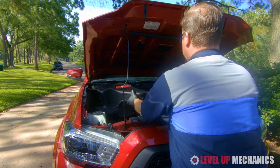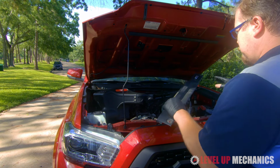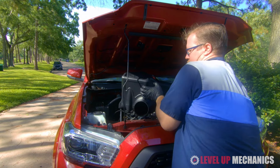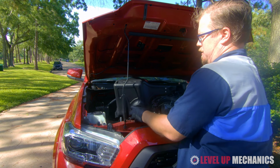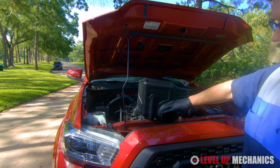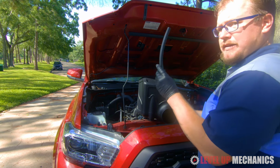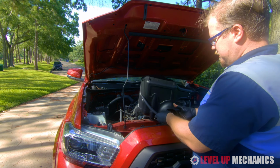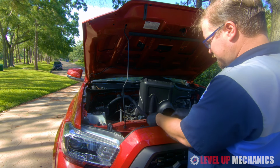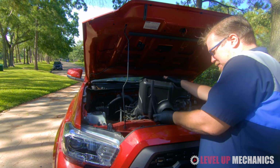Alright, now that the grommets and sleeves are in place, you can set the box down, remove the trim piece, and then we're also going to need to install the weather stripping around this portion of the enclosed box assembly. The weather stripping just sits against the passenger front fender area and allows another access point to draw in cold air through the filter.